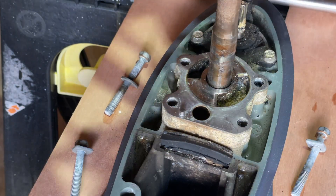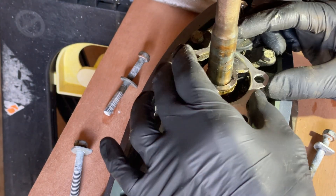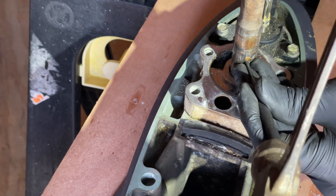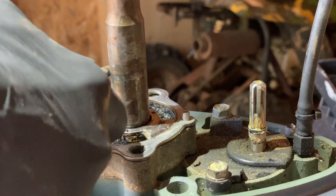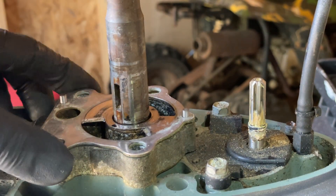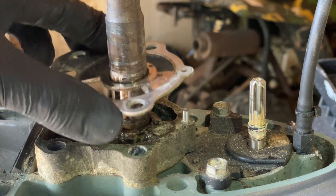Now we can go ahead and take this gasket off. Just find a spot that's sticking out a little bit for this plate and push up on it, using a flathead to start breaking the seal. Once you have that loose, we're going to slide this key out of here. I have a one-eighths inch punch to hit this key with — keep hitting it at the top until it goes all the way and rotates out. Now that we have our key out of the slot, we can take off this plate and the gasket stuck to it underneath. Notice the orientation — it's kind of sloped downwards. Whenever you put your new plate in, you want it to be the same way.